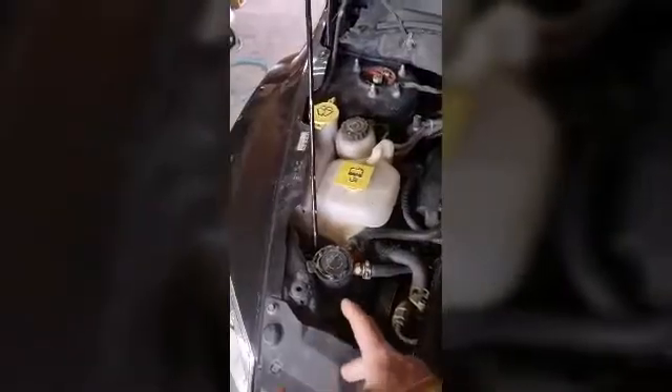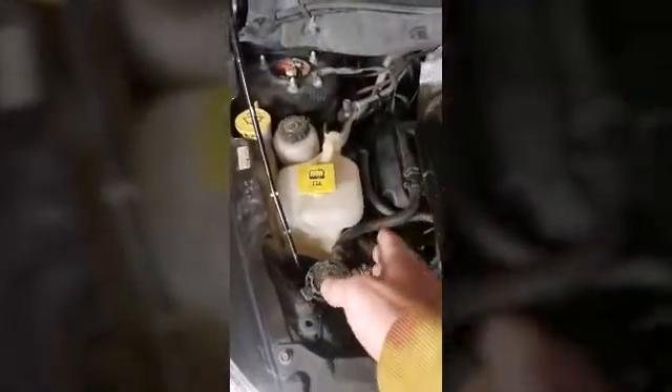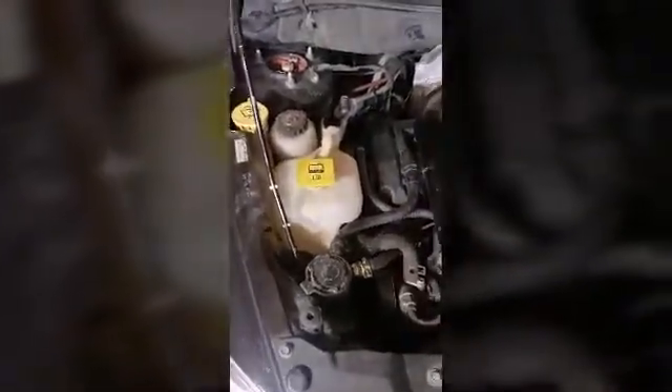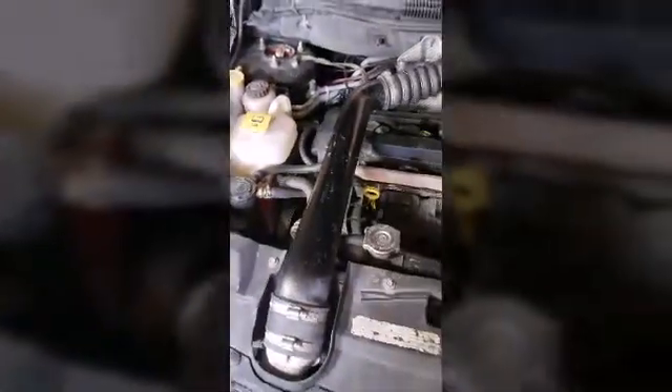First steps are going to be to let the car cool. You're going to want to remove basically everything on this side of the engine. The charge pipe's going to come off, catch can if applicable. You're going to move the coolant reservoir, power steering reservoir, because there's a mount down below that you're going to have to take off. I like to move all this stuff out of the way before I jack the car up - it gets awkward to work on when it gets too high. Then we're going to move down to taking the wheels off, getting it to a decent height that's comfortable to work on, and then dive into actually doing the timing cover and all the stuff off of your serpentine belt.